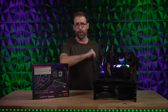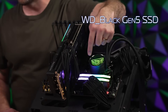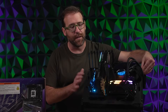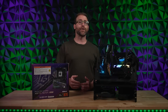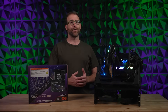Let's put this mobo through its paces. We'll be using an AMD Ryzen 9 9950X3D with 32 gigs of Corsair Vengeance DDR5 RAM, a WD Black Gen 5 SSD, and an ASRock 9070XT Challenger graphics card, all connected to Benjamin Button's, the Newegg test bench. For power delivery and sustained load, we'll be using Cinebench 2024 paired with HWinfo to measure the sustained all-core frequency, CPU package power, PPT, TDC, EDC, and VRM temperature. We're looking for higher clocks and lower VRM temps over time. For memory subsystem performance, we'll be using AIDA64 to measure how trace layout, BIOS tuning, and signal integrity affect RAM performance, and Geekbench 6 for a fast snapshot of CPU and memory performance.